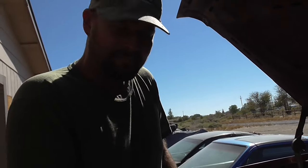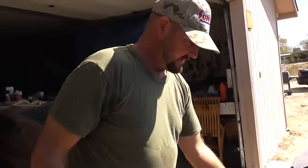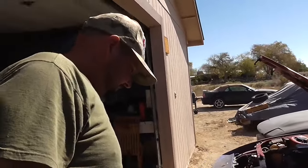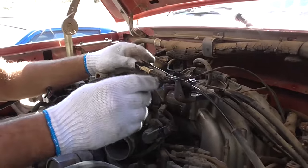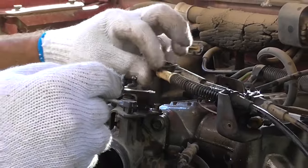This is going to be fun. I already took off the first thing to make access to the throttle. Next I'm going to take off the intake tubes since they're in the way. I've already got the air filter off — I made my air filter easy to remove because it's free flow. I did my own intake mod and saved myself a bunch of money, which you'll see in another video. I'm taking off the intake with a screwdriver. I've removed the intake assembly, then I gently remove the cruise control and the transmission kickdown cable from the throttle body.